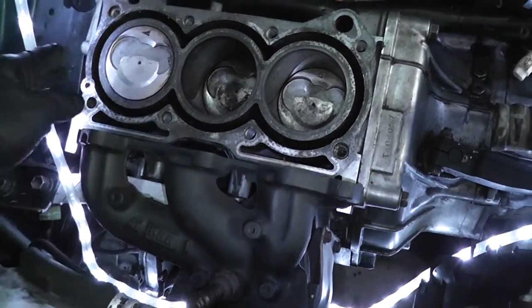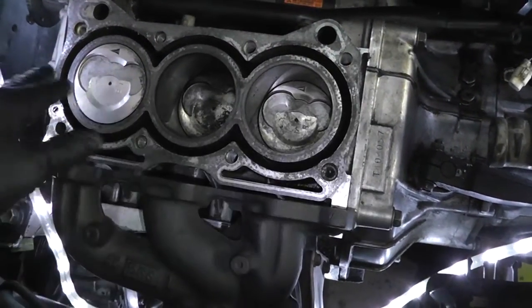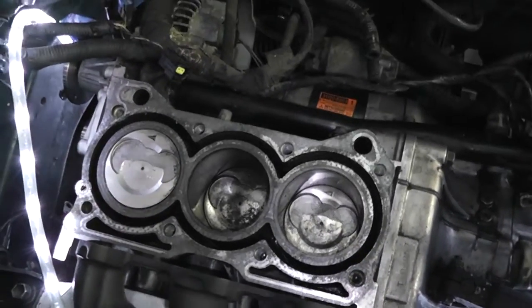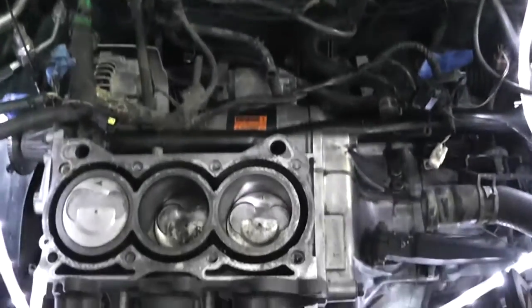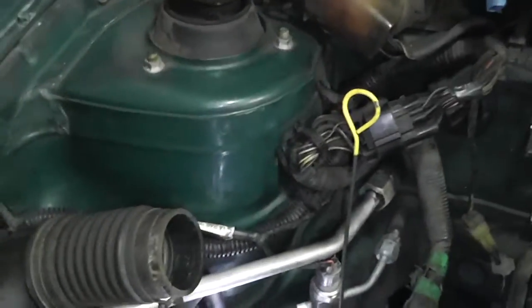Here's the header — it's pretty. Here's the block — it's nice and clean. I cleaned that with a razor blade; that surface is really clean. I shop-vac'd out the old head gasket pieces and whatnot. This is ready to go. I've got all the hoses and wires figured out so I believe I'll be able to put them all back together, and I even cleaned the engine bay.